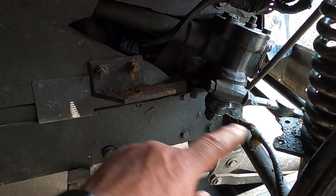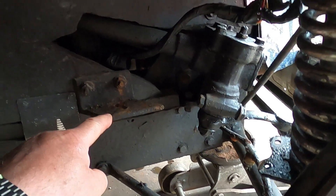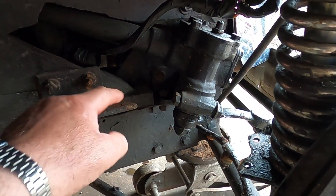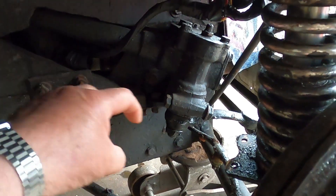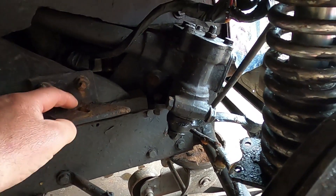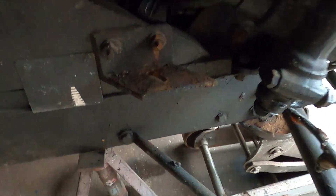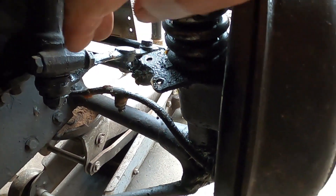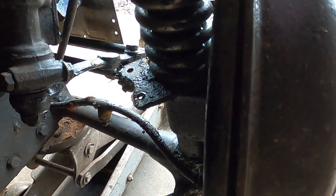This plate here is where the damper blade goes on in my Morgan. I don't know if this is a standard fitment or not — it doesn't look like the later ones, which have a bar across the top of the blade and a couple of shaped shims that just clamp and slide. This one has a bolt through the centre of the blade in a slotted hole, with two fixings on the plate that goes over the spring.